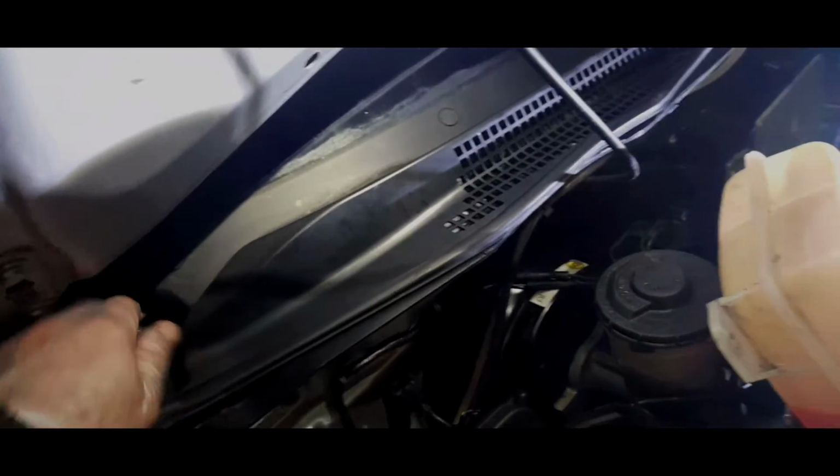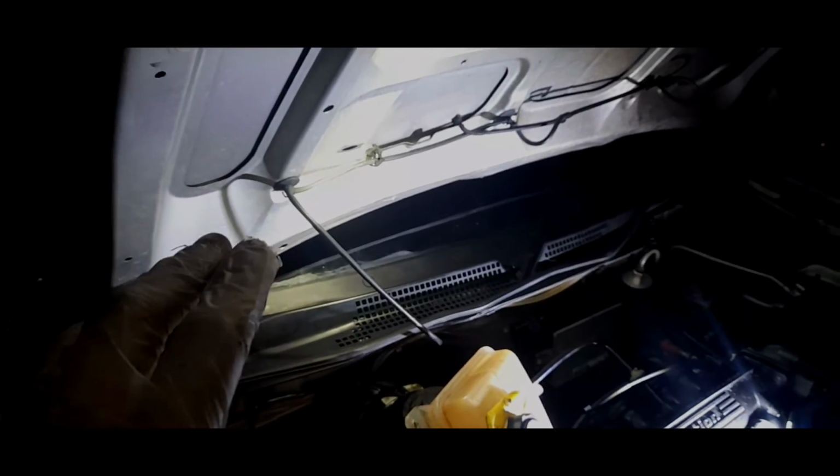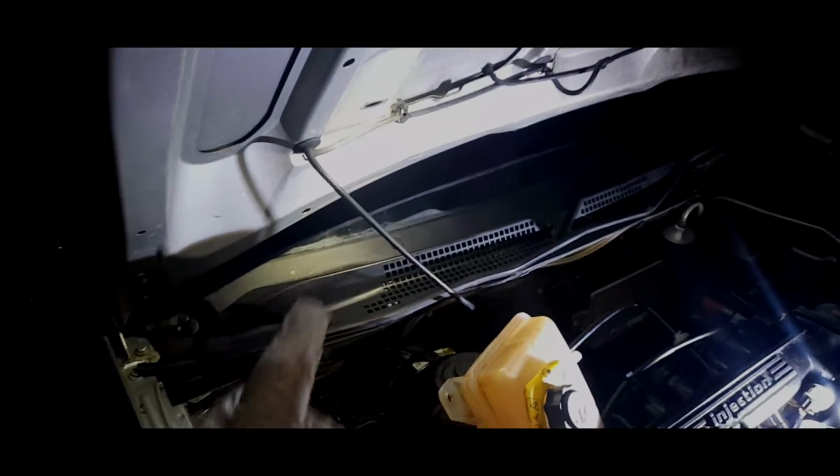Lovely. Right. So all those people saying, oh, you just forgot the wiper arms. No, I haven't. I've put the caps on so I don't lose them. But basically the wiper arms are going to go on at a later stage. I've got new wiper blades coming anyway, but I want to reset the wipers. I want to operate them and then know that they are in the park position, and then put the wipers on the splines in a certain manner. So it might take a few times, but look how clean that is. I mean, that is just superb compared with what it was.